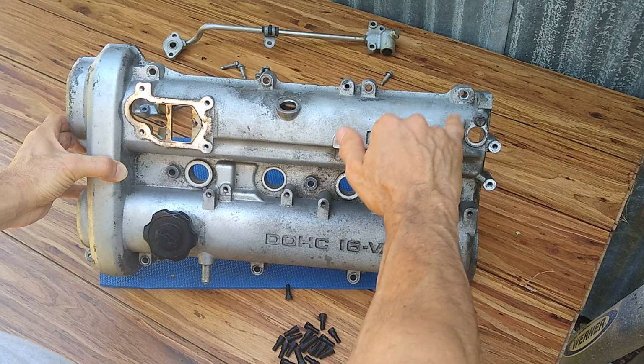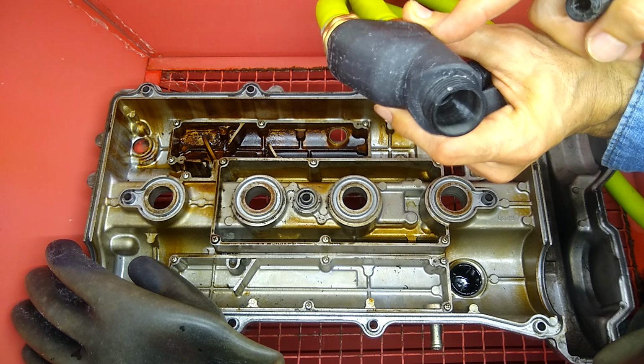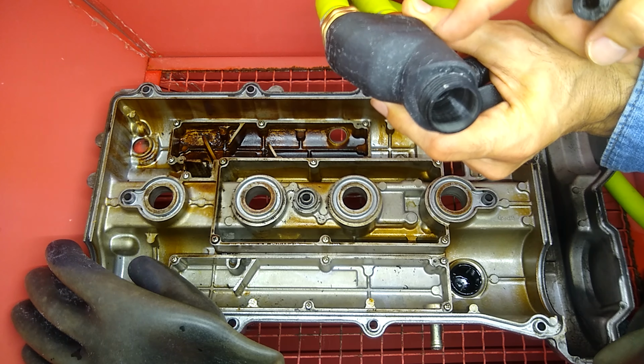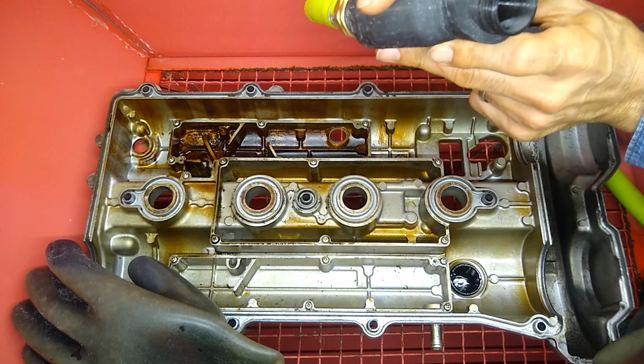One thing that's very important, if you're going to use this 3D printed nozzle, there's an O-ring that you have to get. I currently have it inside there. I'll go ahead and take it apart and provide you the measurements of that O-ring in the description. What I plan to do is put this STL file up on my Shopify store, and if you're interested in trying it out, you can use it. It's been very robust so far. It's gone through about a week of blasting garnet, very aggressive 36 grit garnet. It doesn't have any problems.